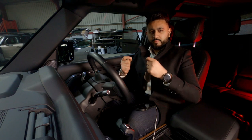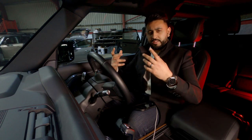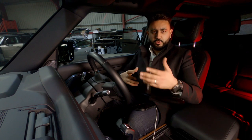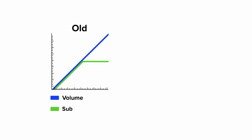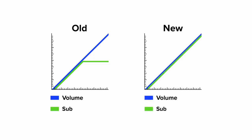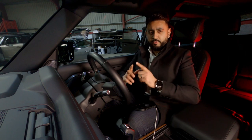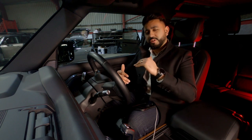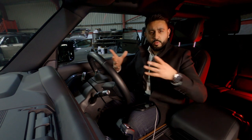The Meridian sound system has one major, major flaw. Basically, because they know that the vehicles rattle like absolute crazy, rather than fixing it with soundproofing like we've just done and actually curing the problem, what they've actually done is — via software inside the factory radio — as your volume increases, you'd expect all your frequencies to increase: your treble, your bass, everything together going up in a linear way. However, that's not the case on Jaguar Land Rover, especially with the Meridian system. Because of those rattles, as you turn up the volume, your bass curve actually decreases around about halfway to three quarters and it starts dropping off. The reason is to restrict bass frequencies — lower frequencies — to your mid-bass drivers in the bottom of the door, in essence to try and stop rattles.